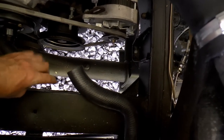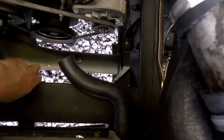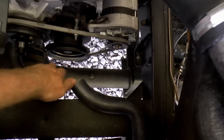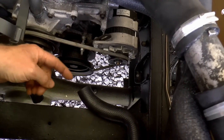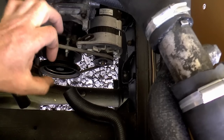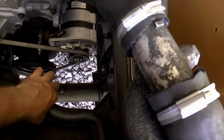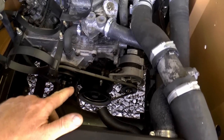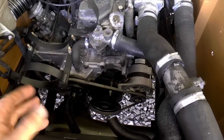So what I'm going to do is order a 10 inch joiner piece, just a straight joiner that will go from there to there. I don't want to just use a piece of pipe because a joiner piece is swaged at each end, so it has the beading on it that'll give something for the Jubilee clip to grip onto, basically. So that'll be a few days to turn up. Other than that, we're there.